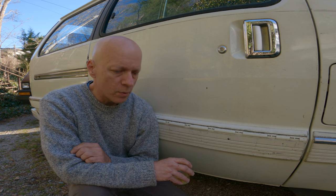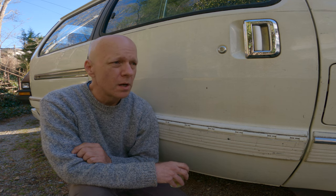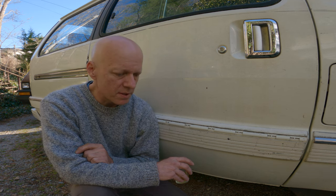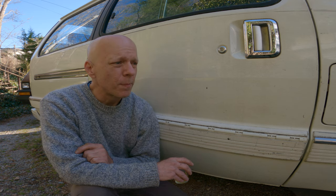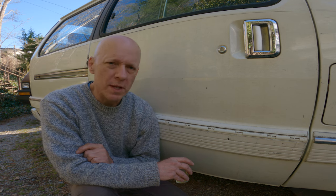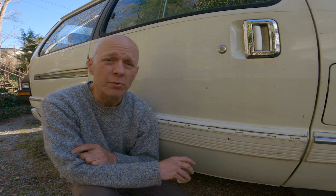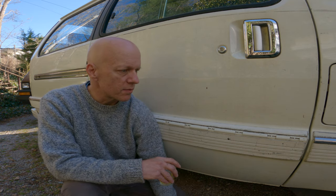That fluid film is for protecting against rust in that bottom tray where the bearing rolls. That bearing down there is really what carries the majority of the weight of the door. So if you can get something like the fluid film that really isn't gonna wash out, dirt and grossness is gonna get in there, but it almost foams up and creates a gel in there. And I feel like once a year you could refresh that and it would help that bearing on the bottom. Any of these things are good to do as far as maintenance.